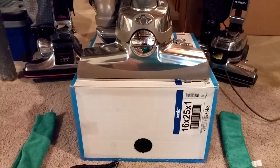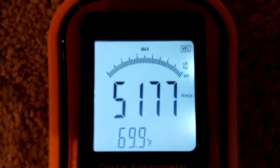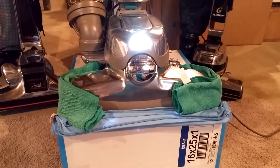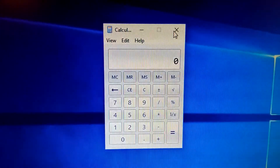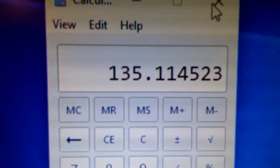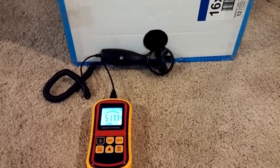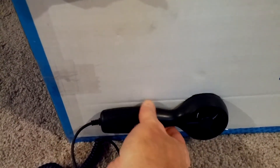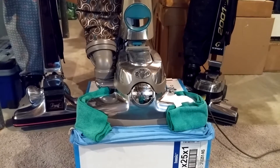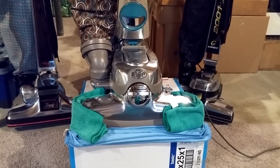I'm going to pause the camera while I go and get the microfiber cloths all set up. Okay, we got 5177 feet per minute times my conversion factor, and we're looking at 135 CFM, just slightly over. What's funny about the whole thing is anything over 5,000 feet per minute or 130 CFM, and this can actually stick to this hole and I don't have to hold it up — it's kind of funny. So there you go. You've got your first live airflow box test with the Kirby Sentria 2, and we topped out at about 135 CFM with the brush roll spinning and a clean HEPA bag installed. See you later.